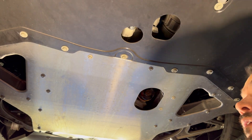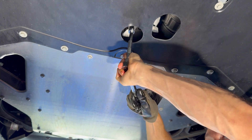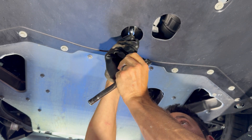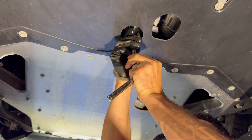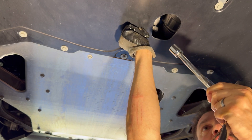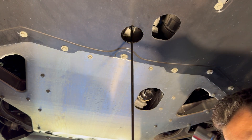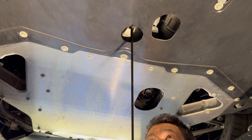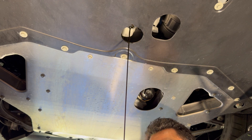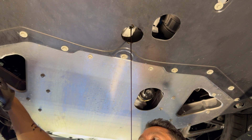Let's get the drain plug out. Prior to doing all this, Blackstone wants you to run the car for 15 minutes, which I did — just to kind of burn off some fuel that gets into the oil when you start a car and move it quickly. So I drained all that off, and this is actually very hot oil, which is usually a little better for the analysis part. I'm going to get this cleaned up and let it drain for a minute.